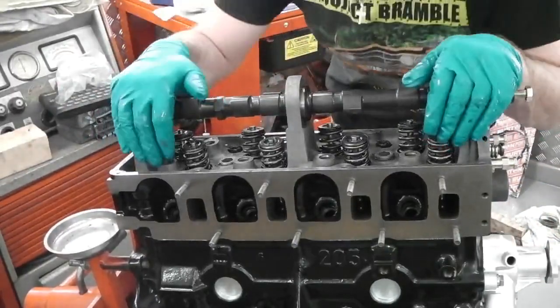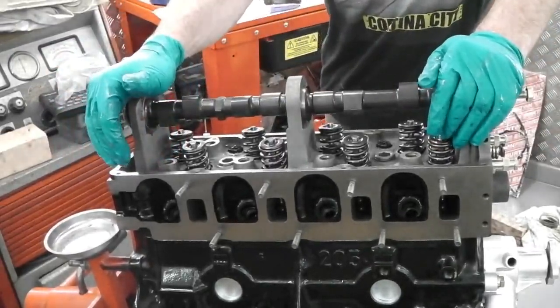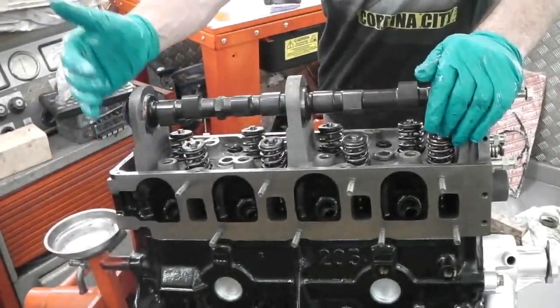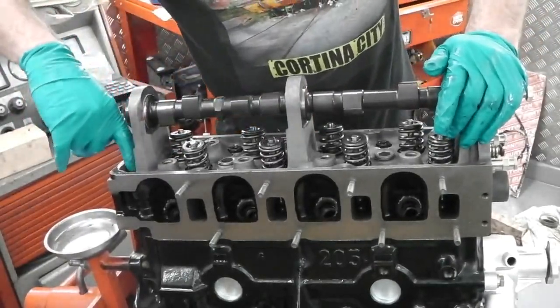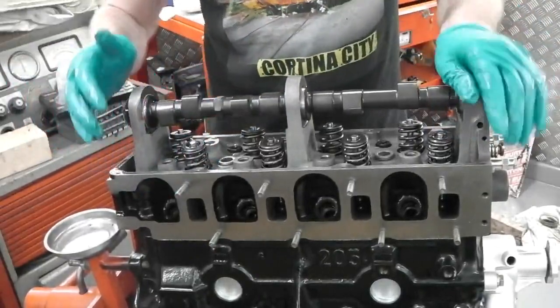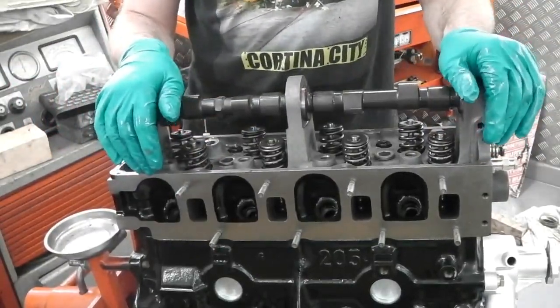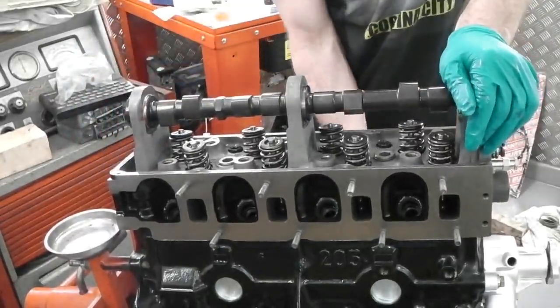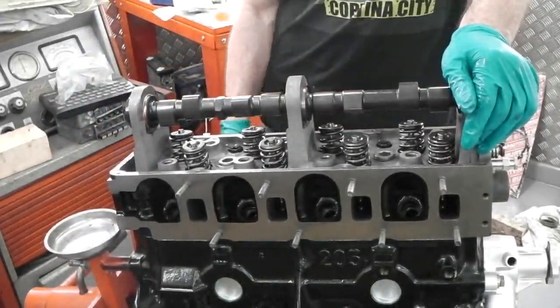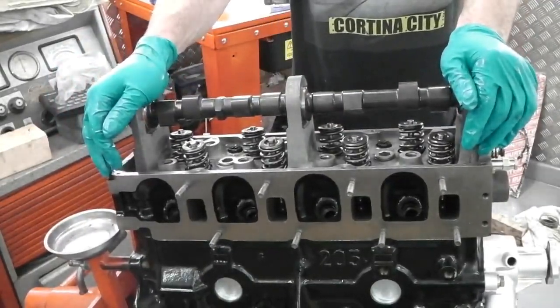The time has elapsed for the 90 degree turn, so we're going to just do our final torque settings on the head bolt. Then we're going to pour some oil down. The galley, oil galley, is at the end here. We can pour in with a funnel and just load this up. We'll just put in a few litres for now. Check on the dipstick where we're up to. Screw the oil filter up. All the filters on this side screwed up. Nothing to stop it. We can see if anything's obviously gone wrong with our gasket on the sump.